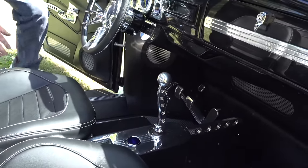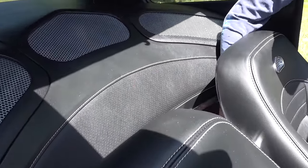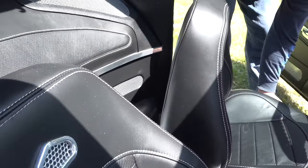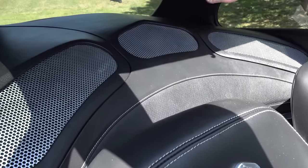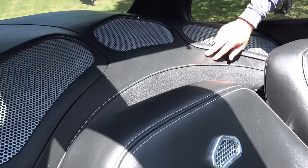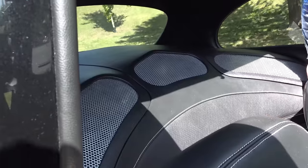Wow, Eric, that is way cool! We've got six-by-nines — two sets of those — and six-and-a-halves here, and eight-inch subs in the back. We've got fans down here that cool the amps, taking air in from somewhere and blowing it out through the seat rails on the side. We got two twelves that shoot straight to the back and there's a screen back there to cover it all — two nines, two eights, two twelves. This has all been fiberglassed and bondoed so it's all hard and doesn't rattle.